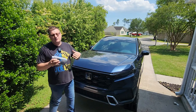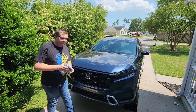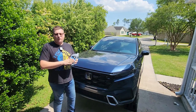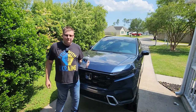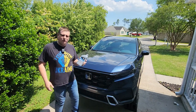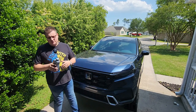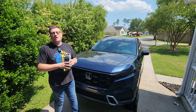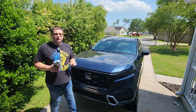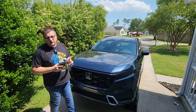According to the manual it's a little bit too early, but it never hurts to change your oil earlier. For this project I picked actual original Honda oil — I went to my local dealership and picked up 5 bottles. Super overpriced obviously, but if you decide to go with something else, for example Mobil One, Castrol, or Pennzoil, just make sure it's 0W20 full synthetic. This 2.0-liter engine takes 4.2 quarts, and 5 quarts will obviously cover this.